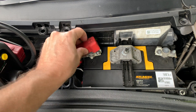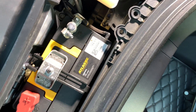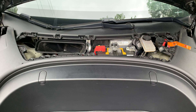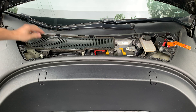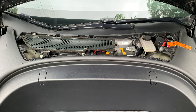Fully discharging an AGM battery is bad but not normally fatal; however, it does reduce the battery's longevity. Normally this never occurs in a Tesla, but if a vehicle is not connected to a charger and the main battery is drained to 0% state of charge, the 12-volt battery may also stop being charged to protect the main battery. Within a few days the 12-volt battery will be drained. Heat can be bad for an AGM battery, but the heat conditions encountered in a Tesla are usually fine — you don't have to worry about a high-temperature ICE engine in the same vicinity.